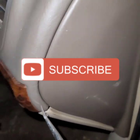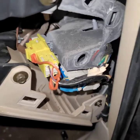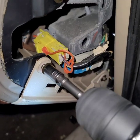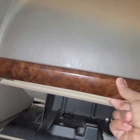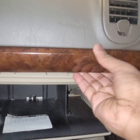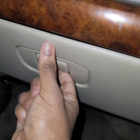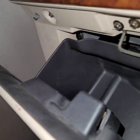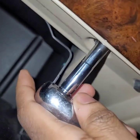Come over to the passenger side panel and do the same thing — just pop that off. You gain access to the two screws on the side, and like I said earlier you need a seven millimeter socket to remove them. Pop this panel off first and that'll come right off. Open up the glove box and look for some screws — those screws have got to come down. Unfortunately my drill won't fit under here so I'm going to have to use a ratchet.